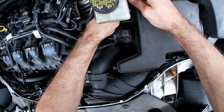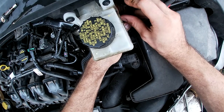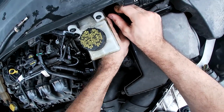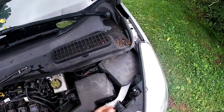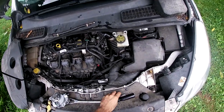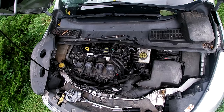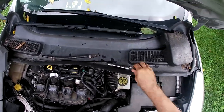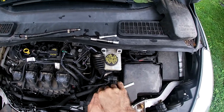First you've got to remove the air intake tubes — those screws are a little hard to get to. We're actually going to remove the air filter box first to get access to everything. A pocket full of tools is all you need: an eight millimeter socket and a quarter inch ratchet, or a three-eighths drive ratchet with an adapter will do the job. You need an eight millimeter to remove the air intake filter box — four screws on it.